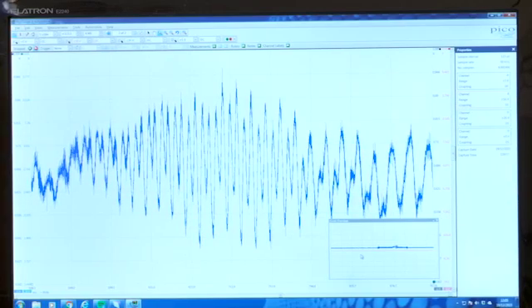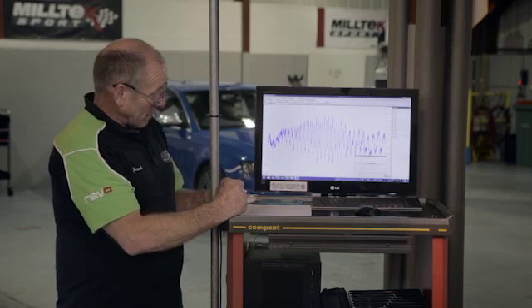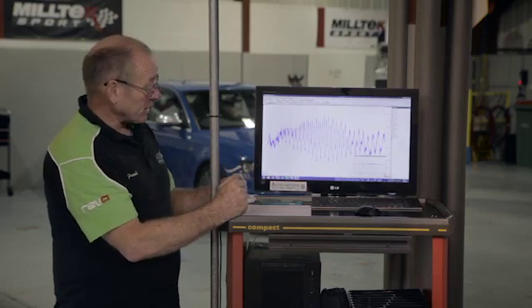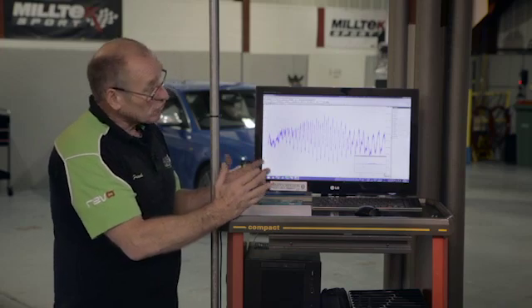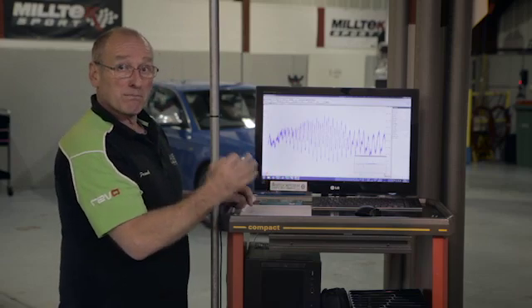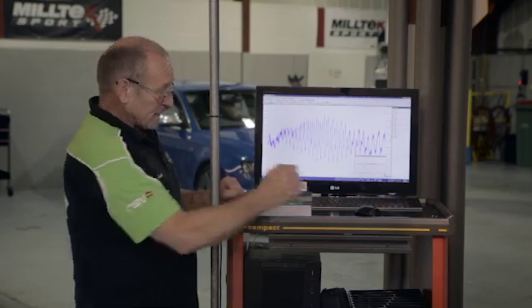That's about as good as it gets in this system. I can predict the maximum pressure is somewhere around 50 to 60 millibars — well under the value I expect. Maximum value at idle: 100 to 120 millibar. On the road on full load: 220 millibar maximum for a perfect system. I'm encouraged by that — I don't see any issues.